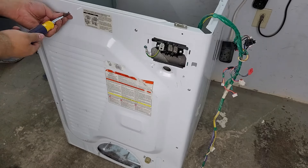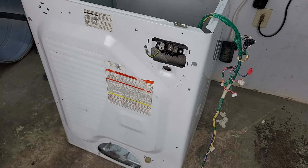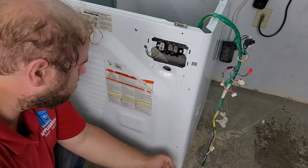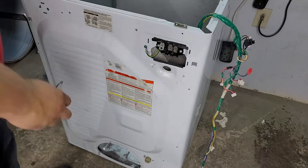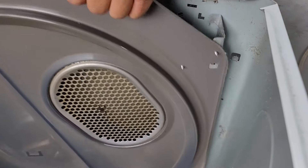On this type of dryer there are six screws on the back of the unit that need to be taken out — this holds the bulkhead onto the chassis. It's possible that your model dryer could have more screws holding the bulkhead on. The bulkhead is held up by two tabs and at this point you only need to lift up and the entire bulkhead system will come out entirely.